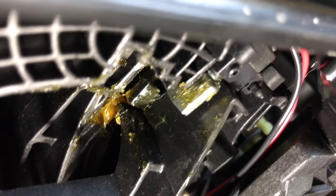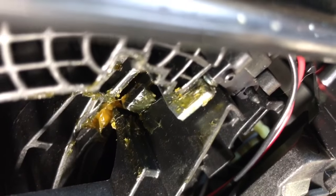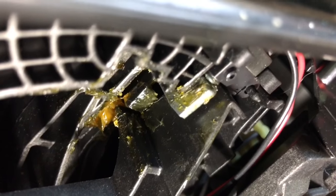In my case, the tab was going in and out intermittently — almost like it was getting stuck. There's some factory grease below it — an orangey yellow petroleum jelly-type substance. I spread some more grease on it and re-greased it, and so far it's been fine. If the tab isn't going in and out when you hit the brake, push it in manually and shift the truck into reverse — that should get you moving and at least get it home.